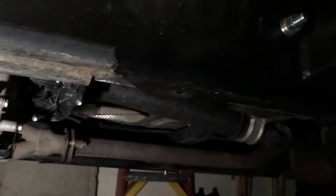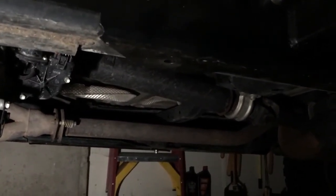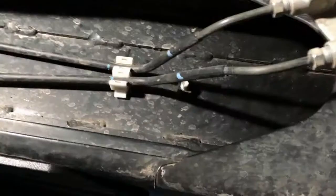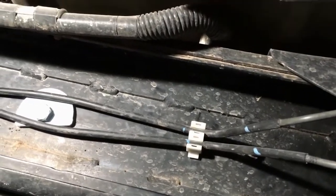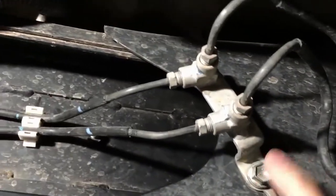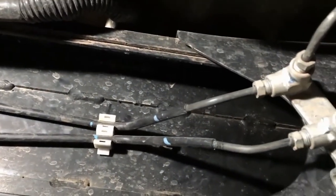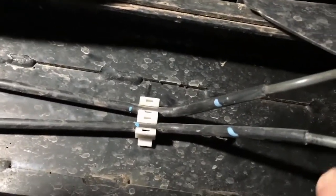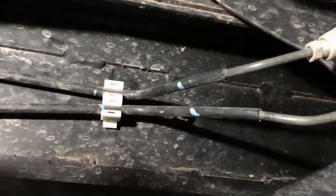And we're gonna swing to the back of it to see the brake line behind the frame rail. Once you install the slider on the driver's side, you got to loosen up this bolt to move the brake line out a little bit, to make it easier to put your hand in there to put the nut and bolt into that bracket that I showed you earlier.